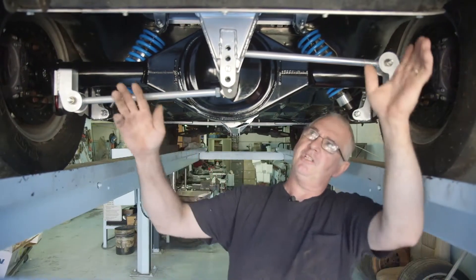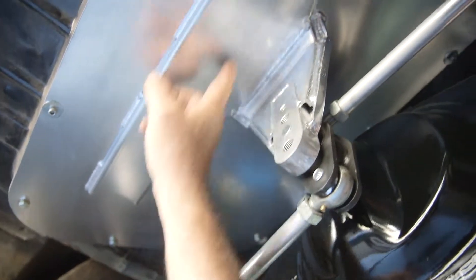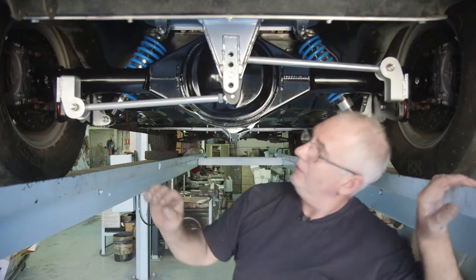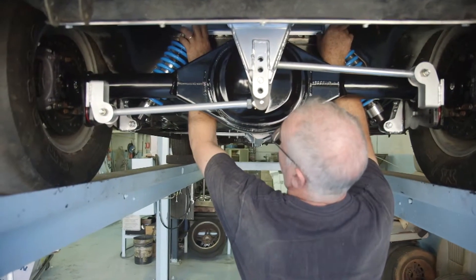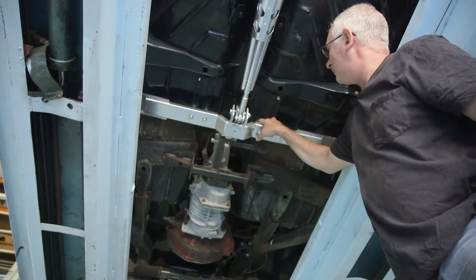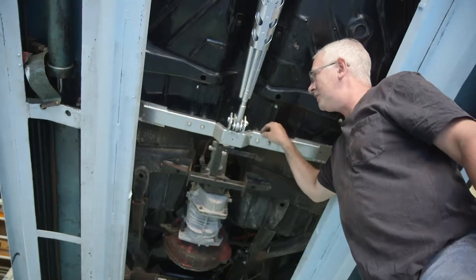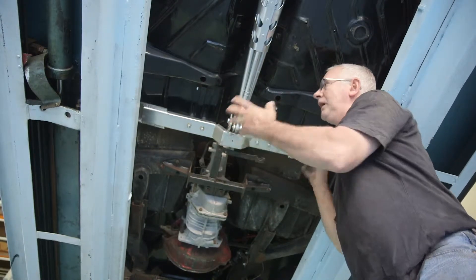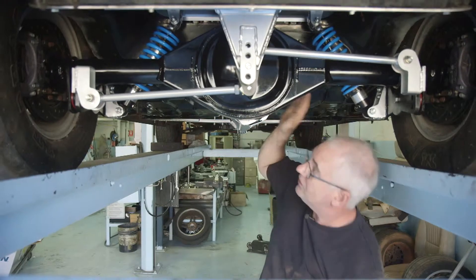Here we are with the completed HK to HG Holden 3-link assembly. As you can see, we've finished all the Watts-link mount — this all bolts in place of the tank, no holes to drill there, unless you want to put heavier bolts in and just drill the holes out slightly bigger. Then we've got the upper shock mount frame, which bolts straight in place of the original shock absorber mounts — that's as simple as it gets. Next is the LRS front cross member, tied into the floor mounting position of the original seats, on the outer and inside, with fixed tubes in the centre. We drill the holes to a bigger 7/16th in the middle and 3/8th on the outer. That gives you all the rigidity added back into the car and a secure mounting place for the torque arm, which attaches to the LRS 9-inch.